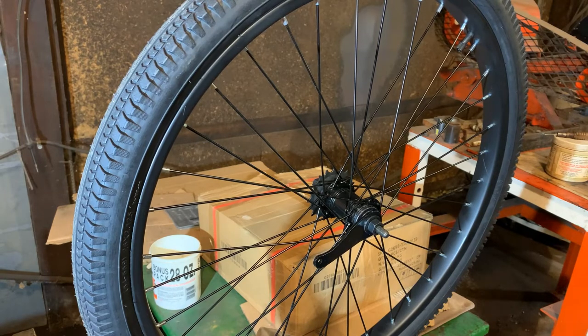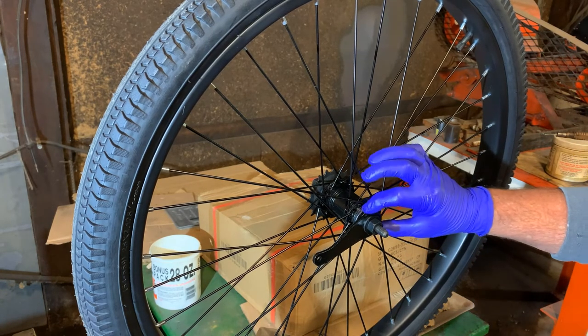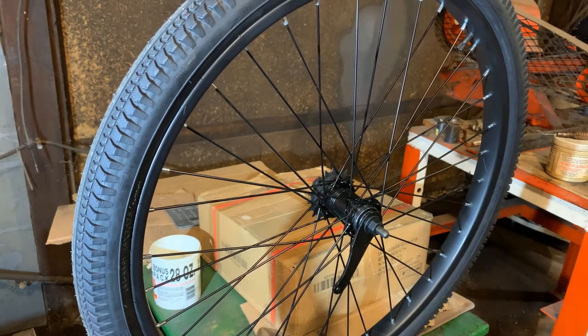I hope this saves somebody some pain and anguish on their coaster brake lubricating, because those parts fall apart inside and it's just a big pain to have to stop, fool with that, get it all back together, or take it to the bike shop and lose valuable daylight building time. All right, I'm going to finish lubricating this wheel, reassemble it, and get my sprocket on there. You always want to keep your dust cap on — it keeps road grime, dirt, salt in winter, and debris out of there, and gives you a lot longer life on your wheel.